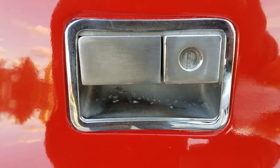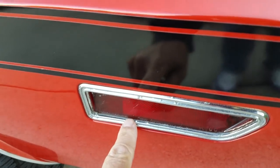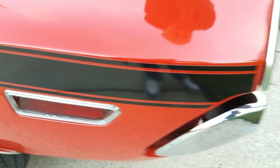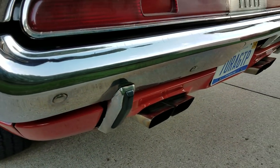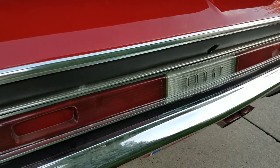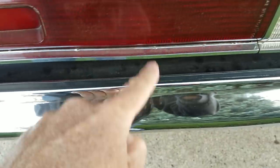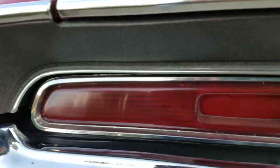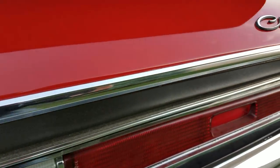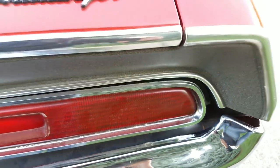There's trim pitting inside the door handles. Wheel opening moldings fit nice. A little bit of stage 1 pitting on the side marker bezels. Rear bumper is in nice shape. Rectangular ported exhaust tips are in nice shape. There are some cosmetic streaks on this bumper — we tried to polish those out while I was here. They clean up a little bit, maybe they'd clean up some more, but we didn't have full success getting them off. A little bit of plating fade on the bumper in two spots.